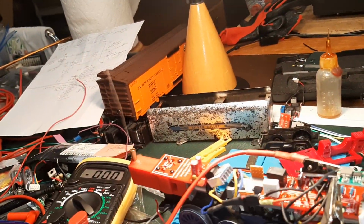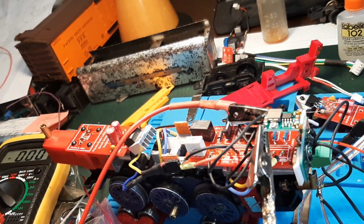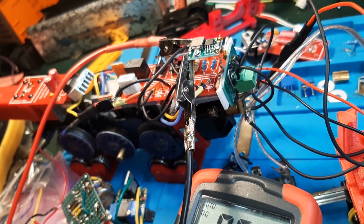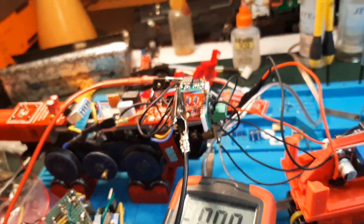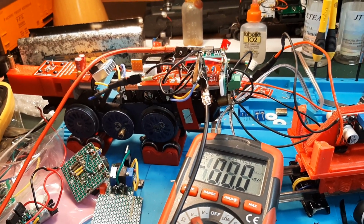Discovery. I cut out the capacitor. I did some more thinking and looking and felt that that was the wrong thing to do. It wasn't working right. I wasn't getting good idle fan smoke. So I cut it out, and I had what's called a mini volt regulator, and it regulates the voltage to 3 volts. I could dial it down to 3 volts.